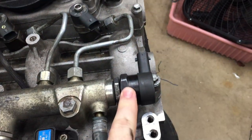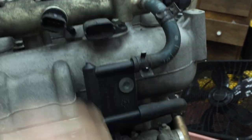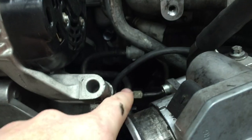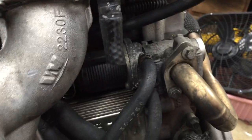If this fuel rail pressure regulator goes out, you won't build pressure in here correctly — it'll just all bypass. Here's the little bypass T. You have your main return line off of the high pressure common rail, a return line going down to the injector with a little gray squeeze clip. That's the high pressure injection pump return, and then the injector top return, and finally the return to the tank.